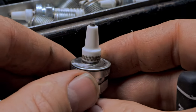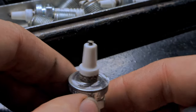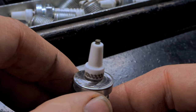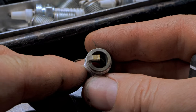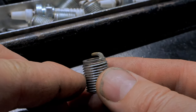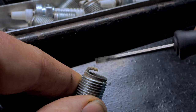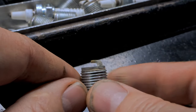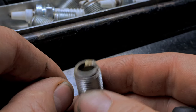And then we have seven. It looks like it has a little more fuel than all the other ones. See this right here? This is a 4-7 swap cam, so that makes sense. Don't see any speckling. Look at this, still see a little cadmium that's not burned off right there. And timing mark, that's a bad side, but right there you can see it. It's right around here, same spot as the other ones. And the heat: we got a little bit of heat into the first thread. So all together, not bad. I'm not mad at any of this.